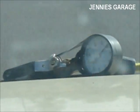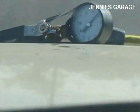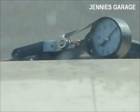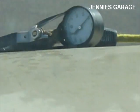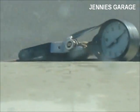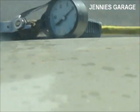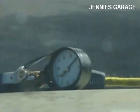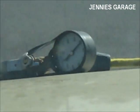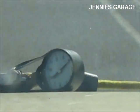Now I'm on the road and we'll see what this thing does. It seems to hold pretty steady. So that's floored right there — and it holds at 60 psi. I think that's a good indication that I've got good fuel pressure and good fuel components.